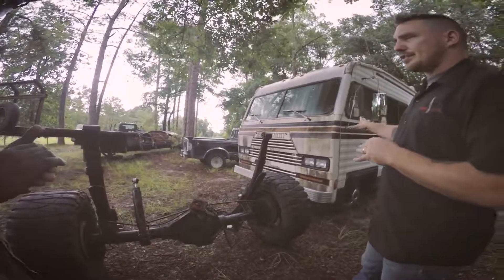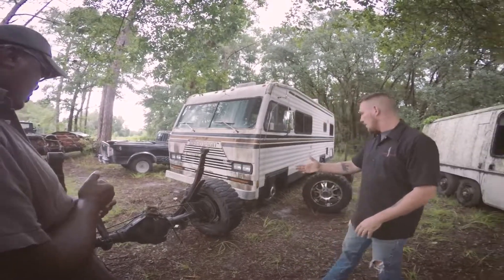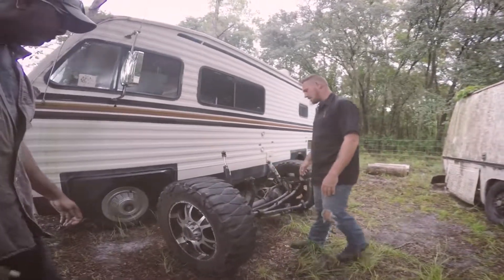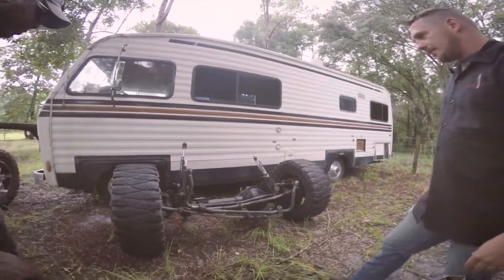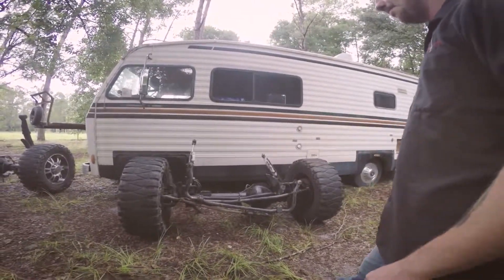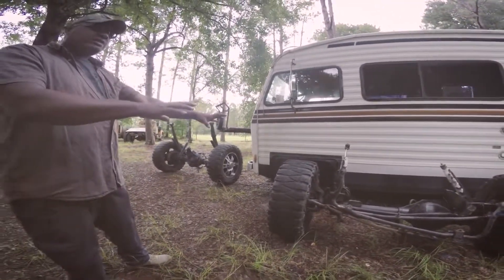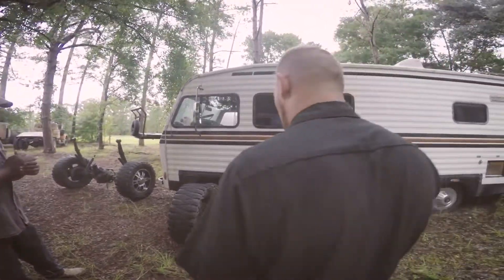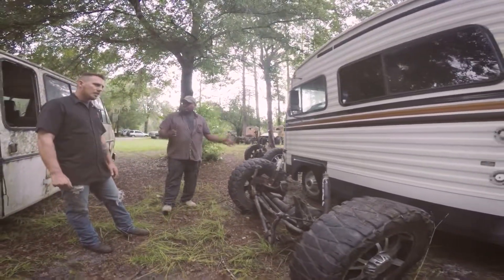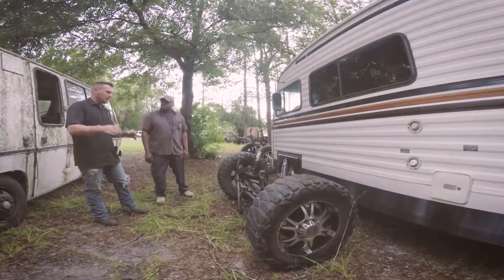The big advantage to using the modern stuff over the old stuff is the ability to get parts, and there's more engineering into it. The front axle is also made by AAM for Dodge - it's a 2007 Chrysler front end. We will be converting it all over to dually. The rear is going to be dually, the fronts will be single. We probably won't have these tires and rims - there'll be a different wheel and tire combo all the way around, as they're not load-rated for as much weight as we're going to be putting on this thing.